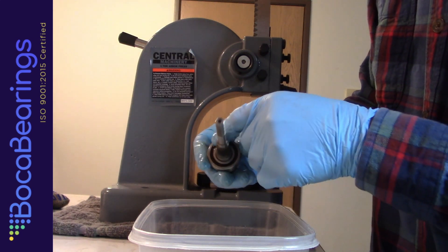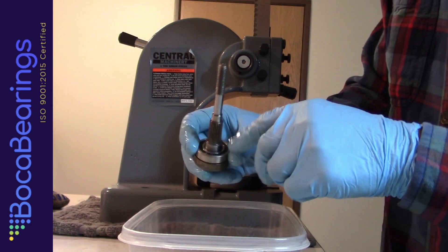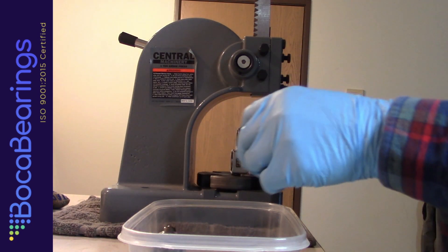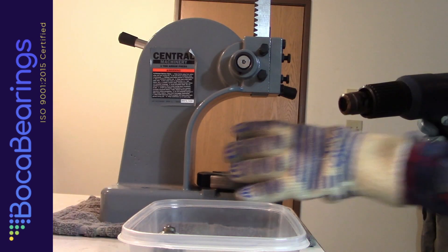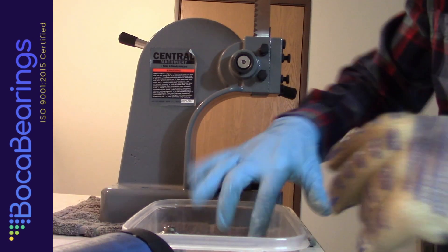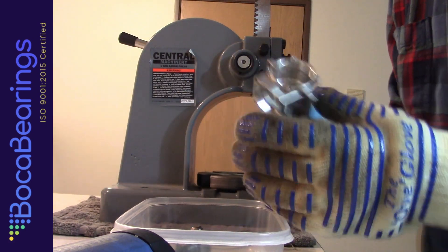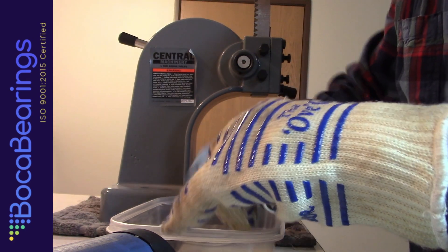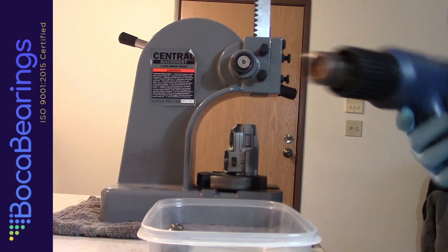I installed this with the plastic shield facing forward and the open end facing rearward. That plastic shield is really not impeding the flow of oil in any way, shape, or form, so it really doesn't matter in that instance. I'm going to put my heat glove on and get this crankcase heated up. I think I forgot to lubricate the internals of the crankcase first — let me do that. There we go, all lubed up and ready to accept these bearings. Now we can heat this up.